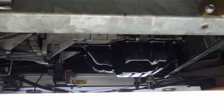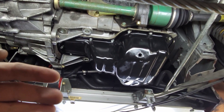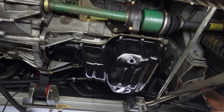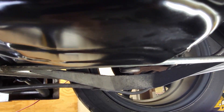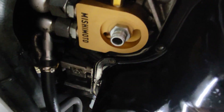The first thing I'm going to do is take out all the bolts to the factory oil pan. I've heard sometimes these stick and are hard to pry off. I don't have a gasket separator tool but I'm hoping to get lucky. Here's where we're at — got 16 fasteners. Most of these are bolts but some are studded into the block, so they come out with a nut.